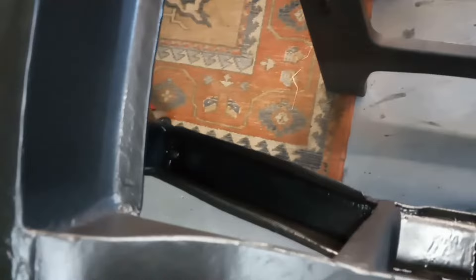That's the final coat of paint applied to the chassis now — I'm very happy with the results. Here is a quick close-up look around the chassis so you can see how well it's covered and the finish I've got on this chassis. I've still got a little bit of paint left over, and what I'll be using this for is for the front suspension towers, which I've decided to spray in the same paint I put on the chassis — the epoxy mastic one-to-one — as opposed to powder coating them.